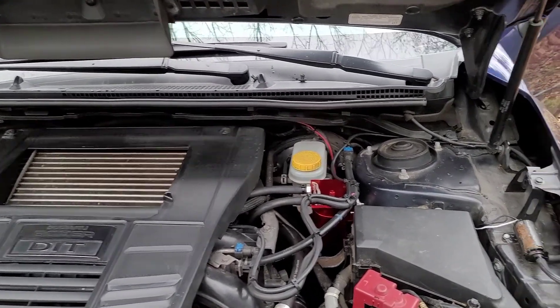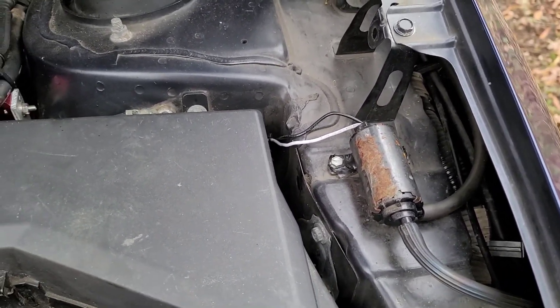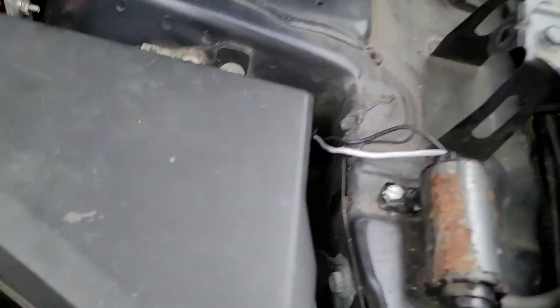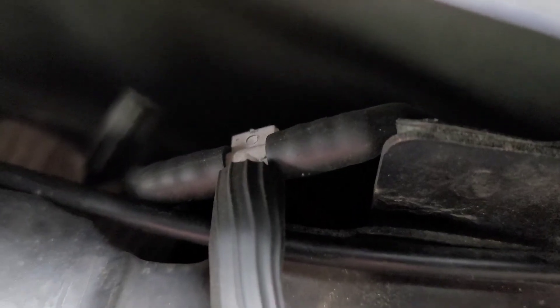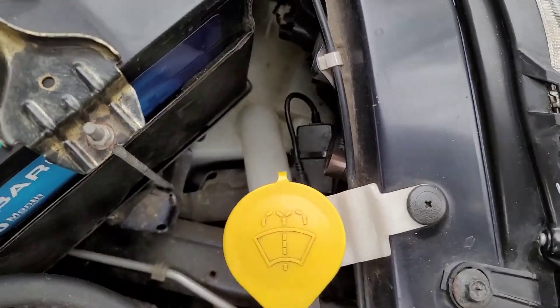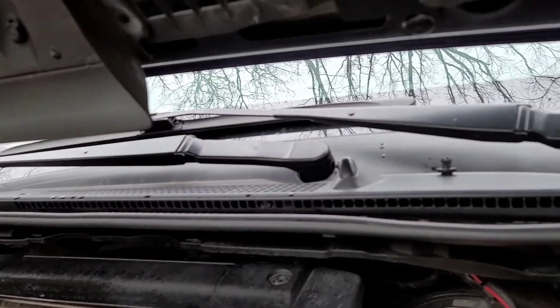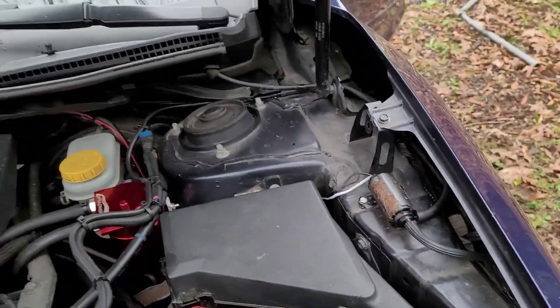What I did is I got this little windshield fluid pump — a universal fit off Amazon. This is the inlet, suction side of the pump. If you follow the line over here, you can see there's a tee I put in. You can buy a set of those tees on Amazon — I'll link everything below. That tee comes from the windshield fluid tank, which feeds your windshield wiper sprayer nozzles, but I just teed off there so I can have it individually powered and draw from the same tank. It also gives me the same low-fluid warning light.